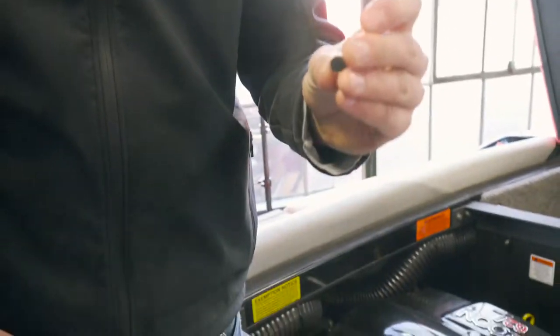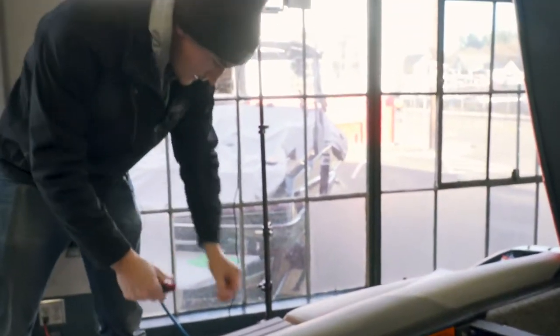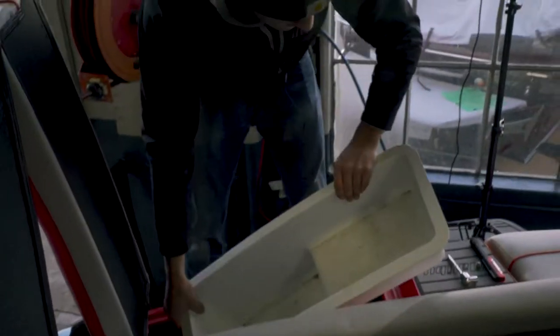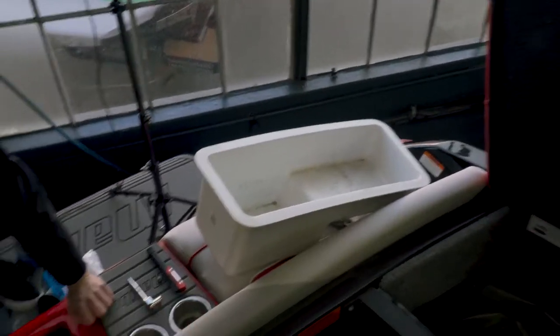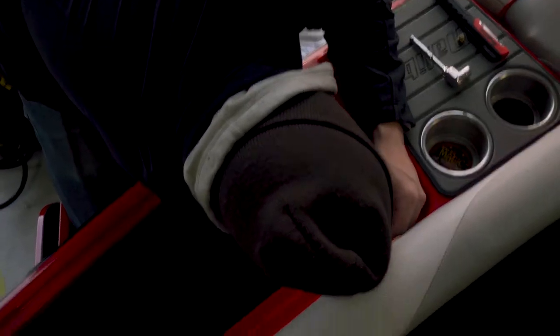You may need a little light for this. This is what that little plug looks like. On the later models there's actually a little hose that runs from it, and you should be able to get that blue plug out from the V-Drive compartment. The last plug you'll have to get to is the heat exchanger. On this Malibu LSV there are these compartments that open up — you take that out and you can actually reach right in there and get that heat exchanger plug.